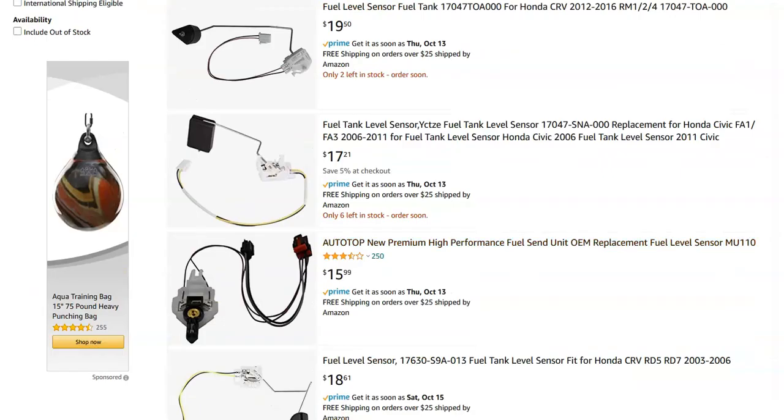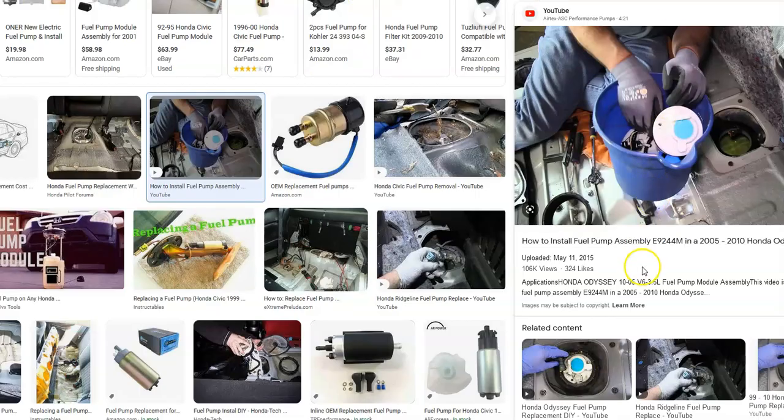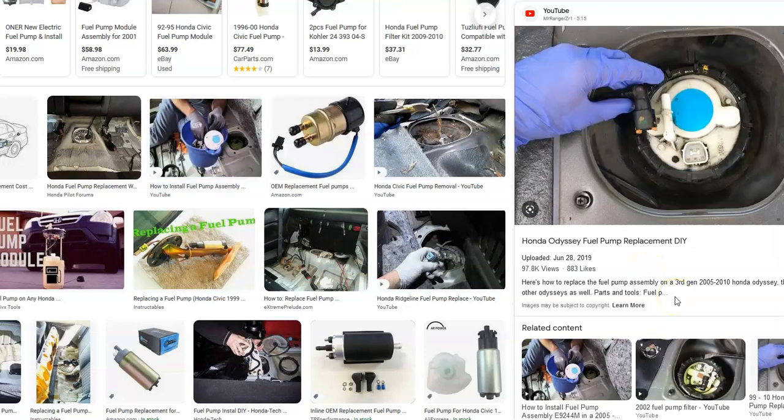The main difficulty is that you have to pull out the fuel pump to replace the sensor, which can be a bit of a pain since you have to deal with gas — so be sure to get gloves. The fuel pump is usually located underneath the back seat. Pull out the back seat, there'll be a cover right there, and the fuel pump will be under that. There's usually a ring around it, and you can get a special tool to help remove it, since the ring can be stuck on there. Some people use a screwdriver to try to pound it out counterclockwise, but it's best to get that tool.